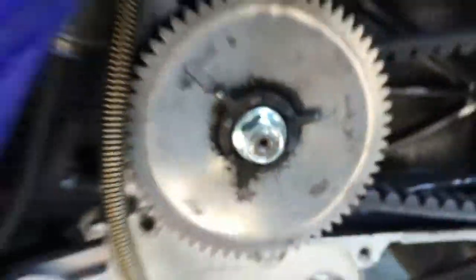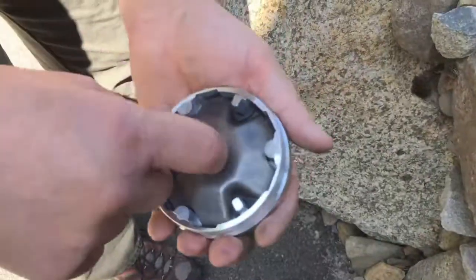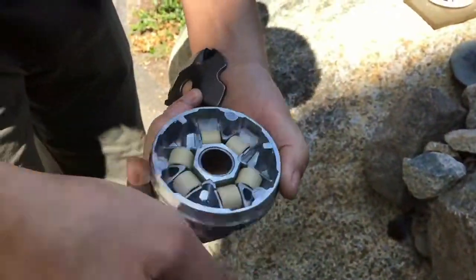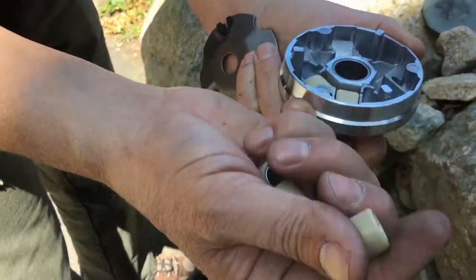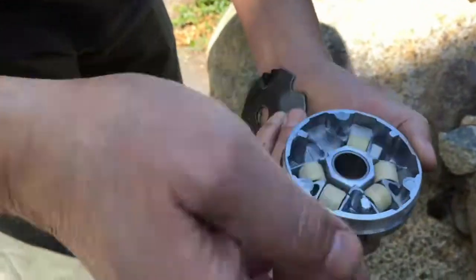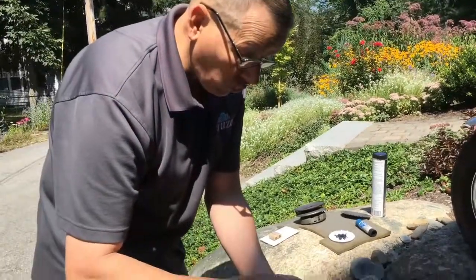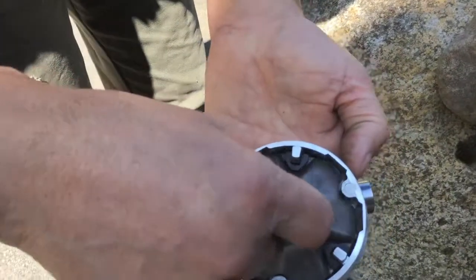So what I'm going to do is change out some components. I'm going to put on a new variator. Those are what good roller weights look like — these little components have to be in there just like they are, and they should be nice and round. If they're not nice and round and they have flat spots, you're going to have strange up-shifting of the bike. It's continuously shifting — that's why it's a CVT. You can feel it up-shift. What you want is smooth operation; this should slide up very easily.